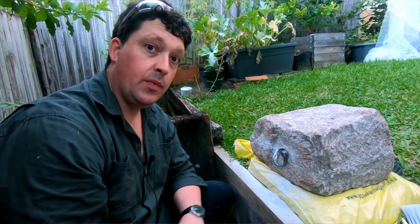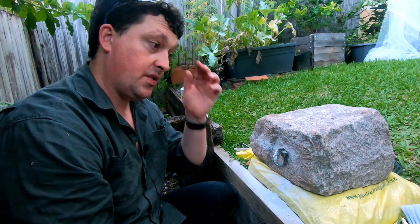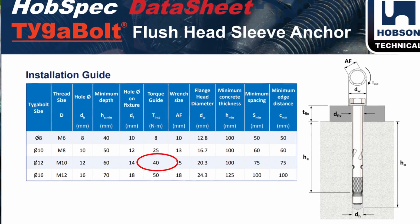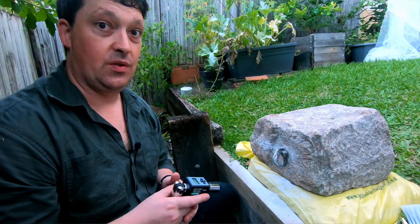That's pretty good going by sound, but I'm not sure what the torque is, so let's check with the torque wrench. For these bolts the spec sheet says you should torque them to 40 newton meters, which is quite a lot. Let's see what that actually looks like.